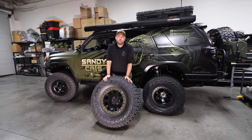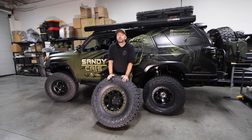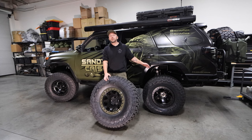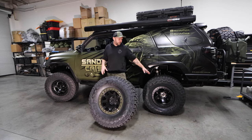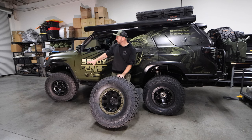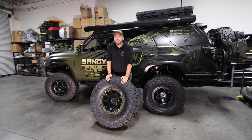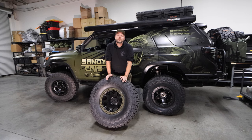The tire can handle most stuff. If you're in heavy snow maybe you want something different, but you want to be light — this is a light tire. And this wheel, for a beadlock, is so light. A beadlock is a necessity for me due to capabilities, but this combination is about 20 plus pounds lighter than my previous combination on a matched 35. On IFS that is insane, because everybody knows the weak links on IFS are the tie rod, the rack, and so on. The lighter you make your tire and wheel combination, the less chance of breakage and carnage. The lighter your combination, the better miles per gallon and the better drivability you get. There are so many perks to being light, and I'm super stoked with this setup — I would now recommend it to anybody.